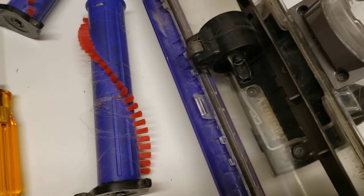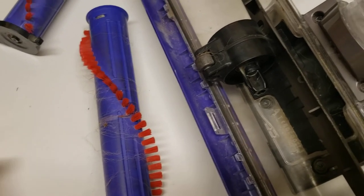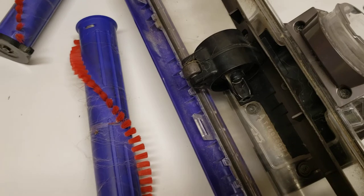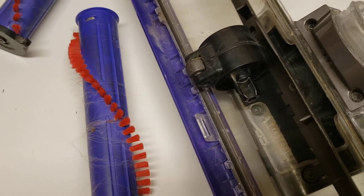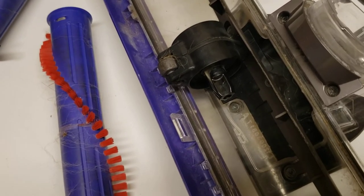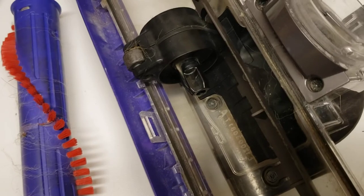For a time frame, this for us takes sometimes as little as two weeks. We vacuum three times a week, and with our dog shedding a lot of hair in the springtime, two weeks is enough that I would begin to smell the burning. I would have to pull the thing apart and clear out the hair that had gotten behind the drive cog.